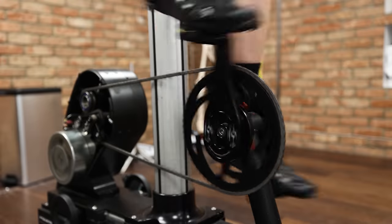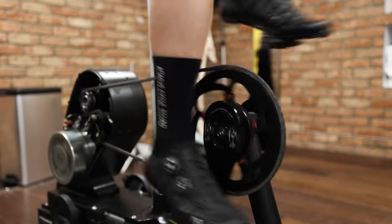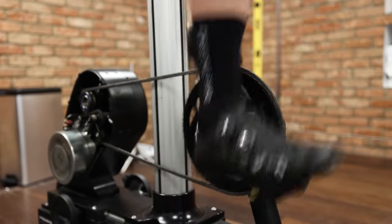The crank length that the bike comes with is probably a pretty good starting point because the crank length on an off-the-shelf bike scales with the size of the bike. That scale is slightly disjointed in that you're still seeing 52-54 centimeter bikes with a 172.5 millimeter crank, which in my experience is probably a little bit on the long side. Those sizes probably ought to be running 170, which is definitely the best selling crank. For the average height man around five foot nine, 170 millimeter is definitely the best seller. 165 for women is also a best seller.